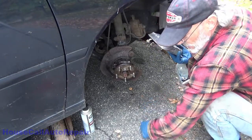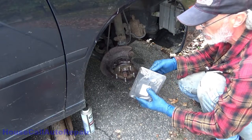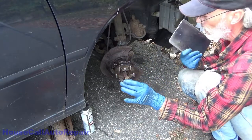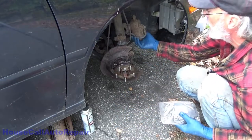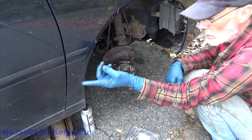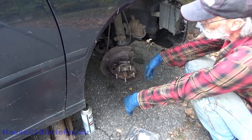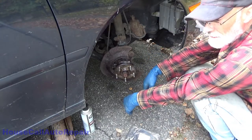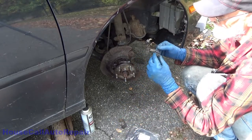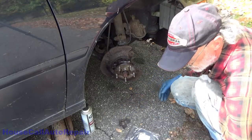It's moments like this that I'm not really a huge fan of — customer picks up his own parts. I don't mind, I just mind when they don't get the right ones. In this case we've got ceramic brake pads, and that's all that's in this package — no new hardware. He ordered new calipers, but I didn't tell him we needed calipers. Calipers come with the hardware, but if these calipers are good, I can't go stealing the hardware from that caliper package. We'll be back in a few minutes — I gotta go get the means to depress the caliper, make sure the caliper is in fact good, and figure out what to do about the hardware. I didn't mangle it pulling it out, so we can clean it up and recondition it if need be. It's not dented, dinged, gouged, or damaged in any way, shape, or form, so we can clean these up and reuse them if we have to. The sound deadening backing plates for the brake pads probably come on the brake pads — yeah, I can feel them.